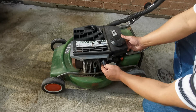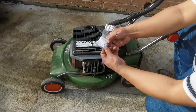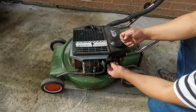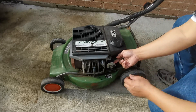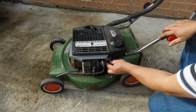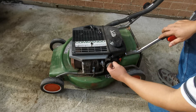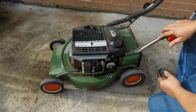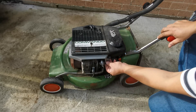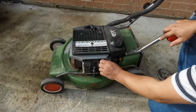I temporarily placed a grommet or ring on the decompression valve, but the new decompression valve actually comes with its own ring sealer. We'll use its own new restrictor. I won't try to run the engine without the restrictor because of the very strong compression and pressure from the combustion towards the decompression valve — it could likely damage the diaphragm inside. So we'll try with the restrictor attached temporarily, but not fully pulled in.